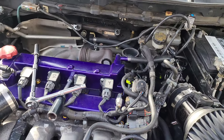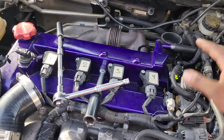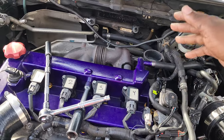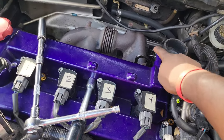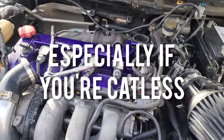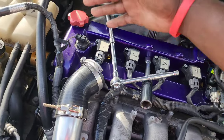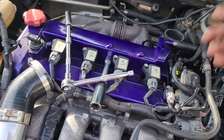If you start up your car one day and it's heavy white smoke, most likely it's time to upgrade the turbo, or just replace the turbo, and go ahead and get that restrictor bolt from Damon. Very affordable, it's like 30 bucks. If anything, also check your spark plug to see if you got any oil in it, because that could be the reason for smoky exhaust as well.